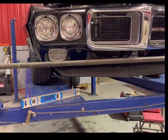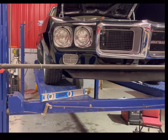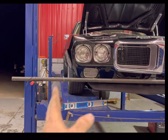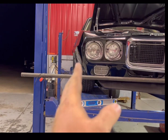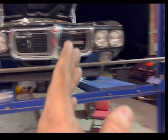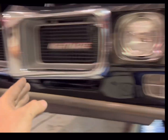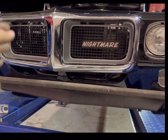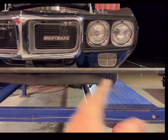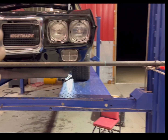So what you're going to want to do, you get your car set up, and like I said, typically do this with jack stands. Tie 4 jack stands, just a string from front to back. You're going to want to start by just eyeballing them, getting the strings looking straight. I know it doesn't look straight compared to the lift, but the car is not on the lift perfectly straight. But you just eyeball it down on each side, get a rough measurement, and then we're going to measure from this string to that string in the front or the back and get that measurement. Okay, so mine tonight was 73 inches. So 73 inches from there to there. We go to the back, move one side to 73 inches from the other side.